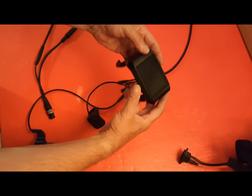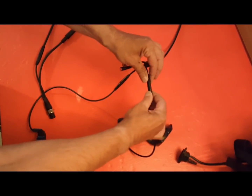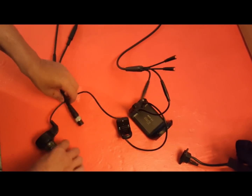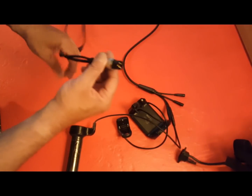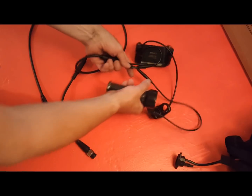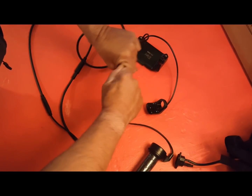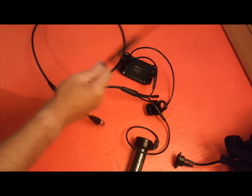Here's the LCD — it's all connected by one wire to these quick disconnects, which are waterproof, which makes my life a lot easier for assembling this. You've got a connection to the throttle, a connection to the LCD, and then it all connects to the rear hub where the controller is with a twist-on that makes it waterproof and tight. They're snug, they do come apart obviously, but this really keeps the water out and keeps them protected. It's just a great, really simple system.